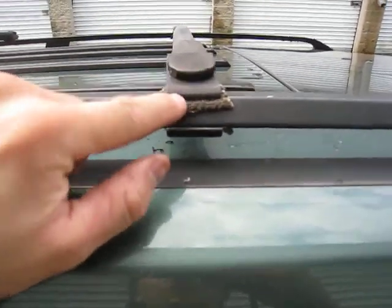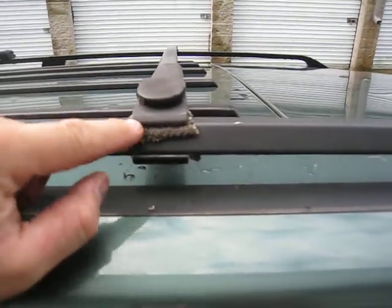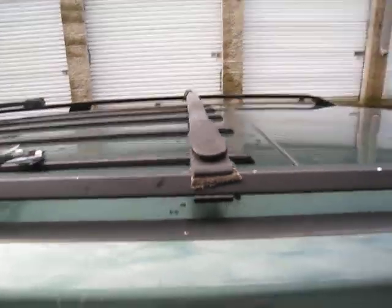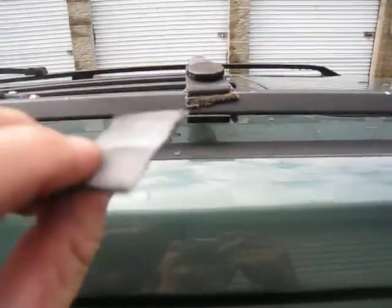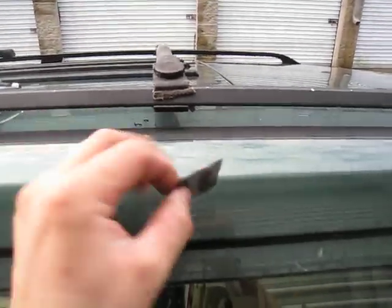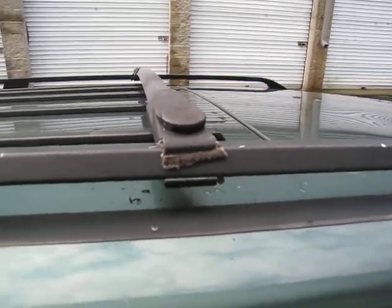In any case, if you put these little strips of old work glove or something else, like those old rubberized pads, something along those lines in there, as you can tell, it's a lot stronger. I haven't tightened these down all the way, so I was able to move it a little bit. But if you're familiar with these cars at all, once that pad gets sticky, they won't hold anything at all. They won't hold 30 pounds without sliding back and just completely ruining a day.